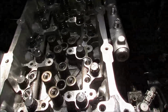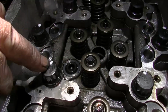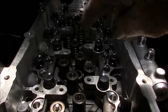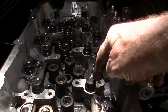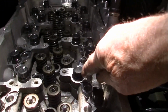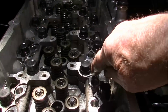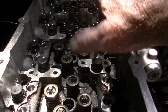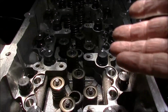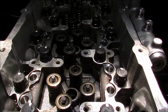There we go, we're all down to 49 newton meters. You guys know the drill. I marked the head bolts. Then we're going to swing around 120. Remember, that's 90, that's 180. So I'll just double check exactly whereabouts it's going to be. Yes, I know, degree wheels and such and such. Look, half the time there's nowhere to put that, and it's just a pain in the ass to use.